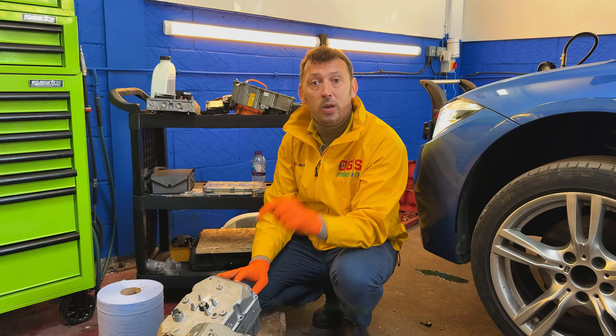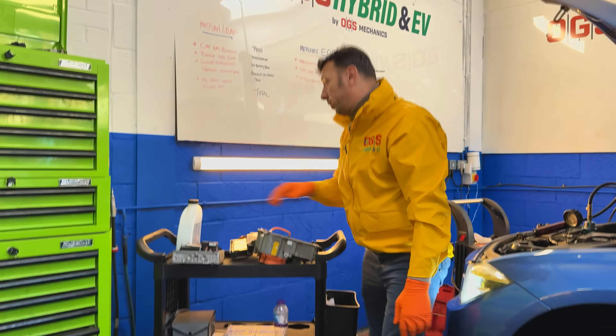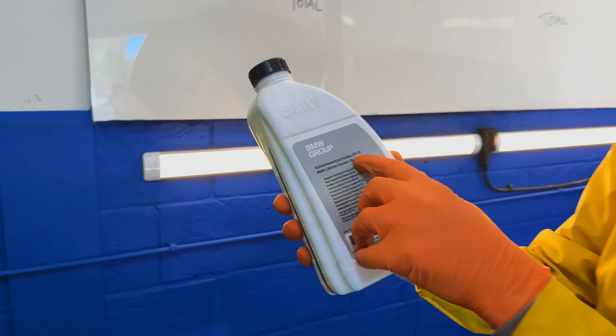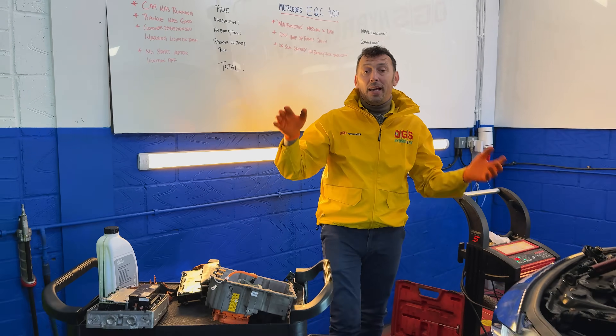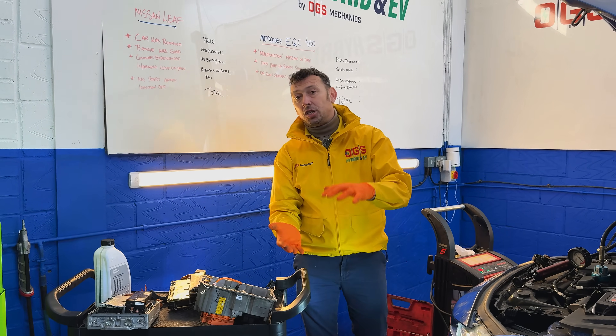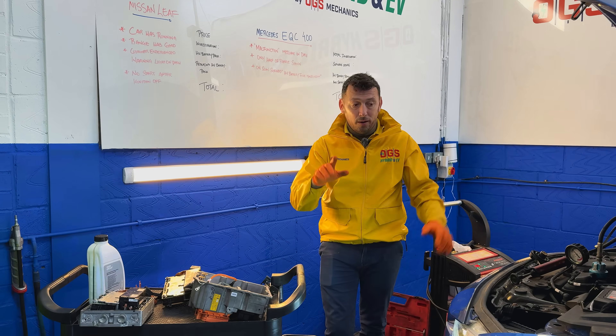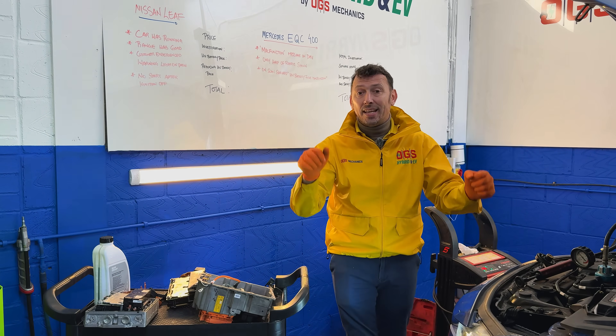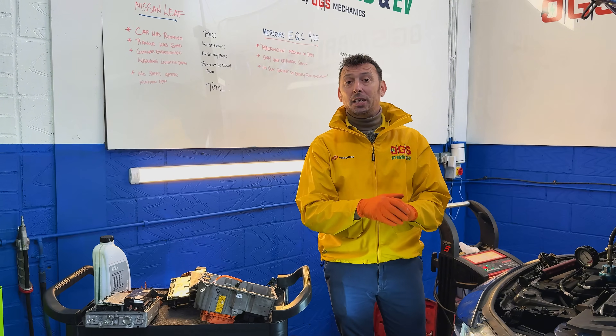What is different for the inverter is that this unit is coolant-cooled — water flows through here and inside this chamber, keeping the inverter cool. However, the coolant on its own — which is also a special coolant, specification HT-12 for BMW — is not capable of maintaining such a low temperature. Therefore, the coolant itself gets cooled with air conditioning.